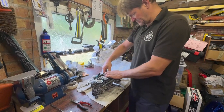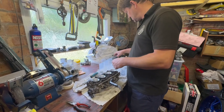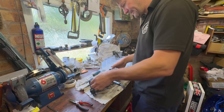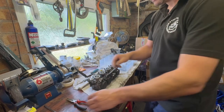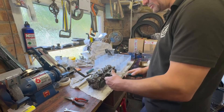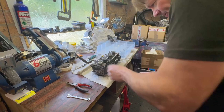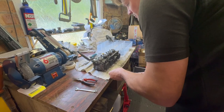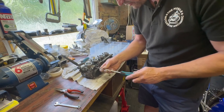I'll start by removing the housings. Absolutely filthy but no worries. Remember how they were on the bike — this is now number one because we've turned them over. We just want to take the lid off. I think we can take the lids off without taking the choke mechanism off — we'll find out in a minute.